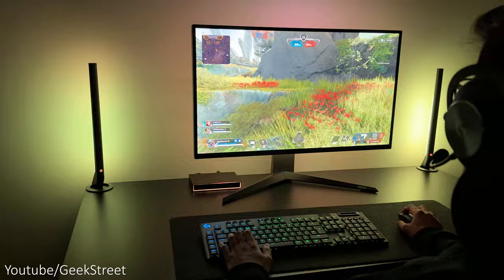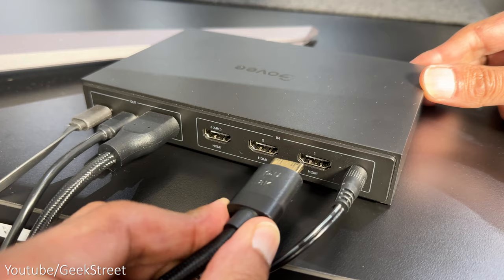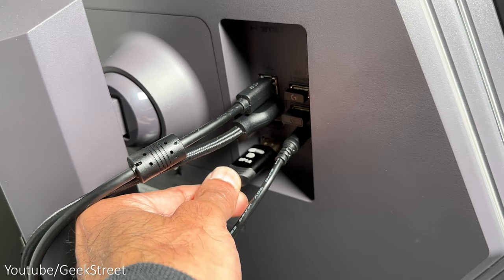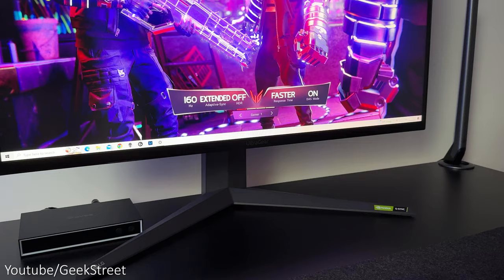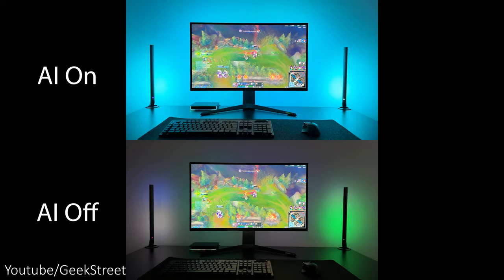I have found a workaround on a PC allowing you to achieve higher refresh rates at 4K. For this, you just need multiple output ports from your PC — plug one into the SyncBox and keep that at 60Hz, and plug the other one into your monitor, duplicating the displays. As you can see here, I've managed to get a 4K resolution with a 160Hz refresh rate.